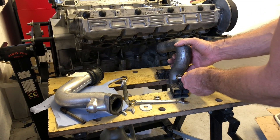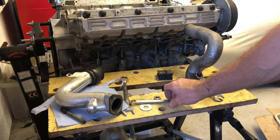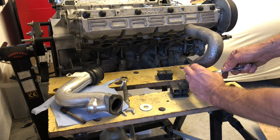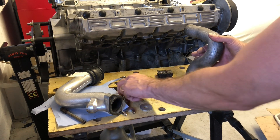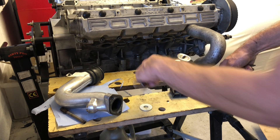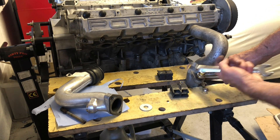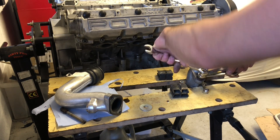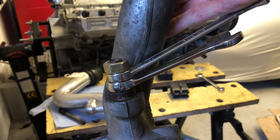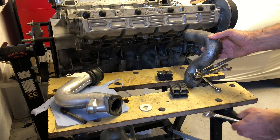Because I've started this one already, I just put that in the vise. I need two spanners and a 12mm nut. That goes on there like that, and then what I do is just wind it up and it pulls the injector up. By doing this, obviously the nut can't go down, so as I'm winding it, it has to pull the injector up. So there's the combination - you can see now the injector is starting to poke its head out. I just keep doing that for a while and it will come free.